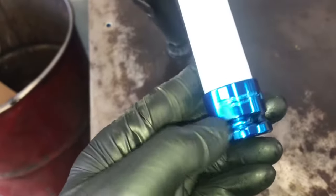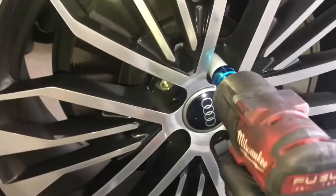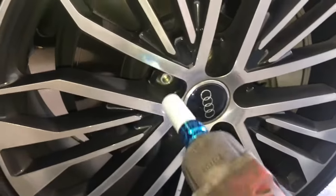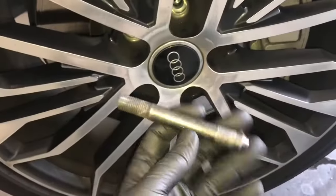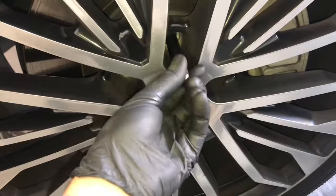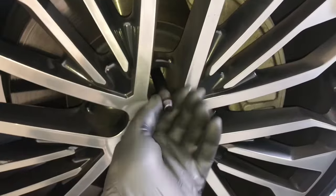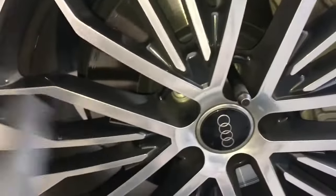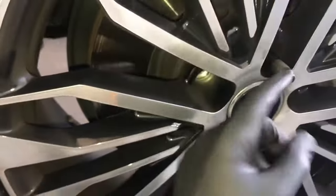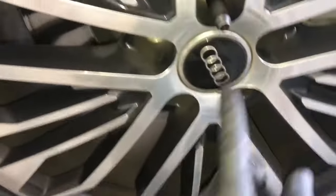I like to use these special sockets with a nylon sleeve over them. It helps prevent the wheels from getting damaged, especially working on these high-end cars. After you remove all the lug nuts, the wheel most likely won't want to just come off — they like to get stuck on the hubs. So I screw in this pilot tool here. I'll link up all these tools in the description. I get a rubber mallet and tap the back of the tire from the rear, and that stud tool keeps the rim from falling off. Once it's knocked free, you can pull it off and set it aside.